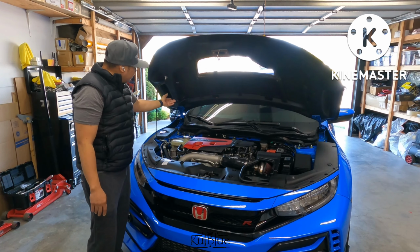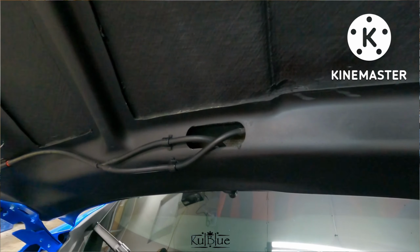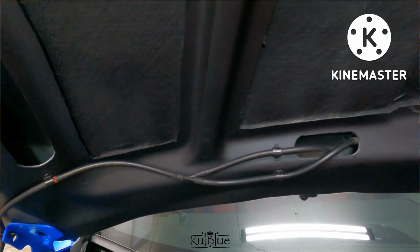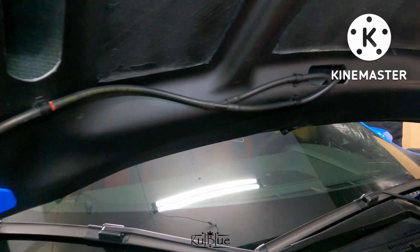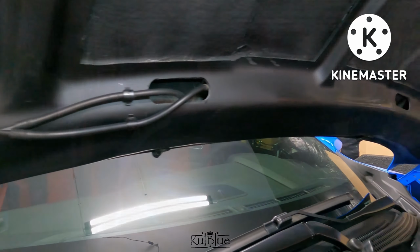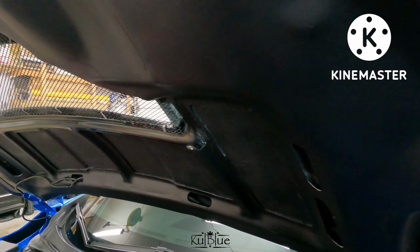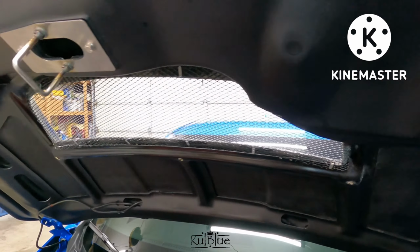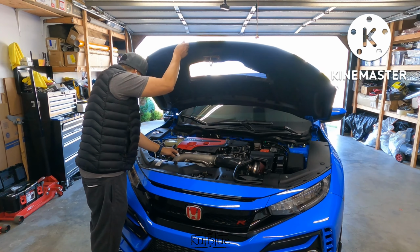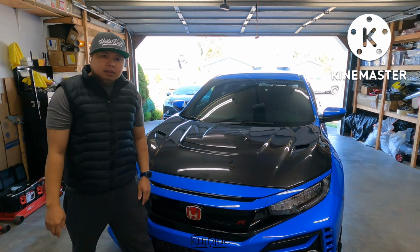But anyway, here you need to trim the washer nozzle. I trimmed that one with a file, little by little, to fit perfectly. Then now I drill over here, and I'm going to do this one too over here. Oh, sorry guys, I ran out of battery. And yeah, just tighten this, drill some holes, and make sure this secures your hose for the water. And that's all. Then everything is good. See how I slam it? Just slam like this. Boom. Right there. Alright guys, thank you for watching.